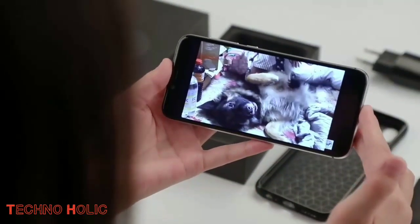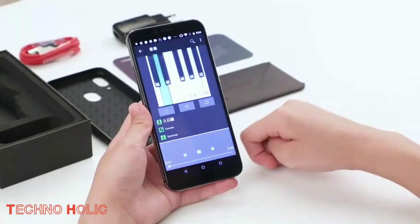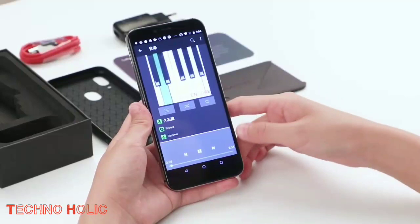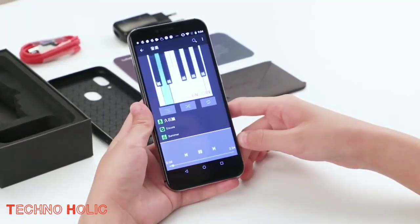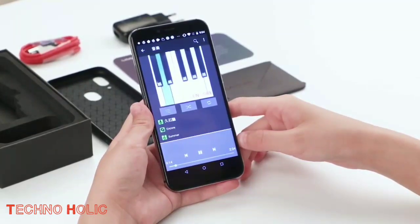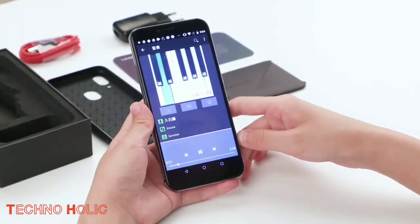Let's talk about its hardware and performance. It has the Mediatek MT6739 processor, which is common in many budget smartphones. This is a 64-bit quad-core chip with four ARM Cortex-A53 cores clocked at 1.5 GHz. It has 3 GB LPDDR3 RAM and the PowerVR GE8100 GPU. These specifications handle normal lightweight usage and multitasking, and the Mediatek MT6739 is a suitable choice due to its low power consumption and high efficiency.